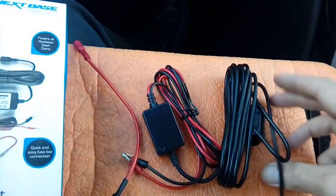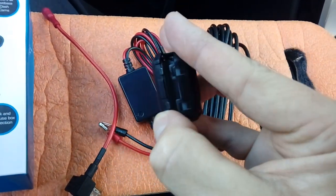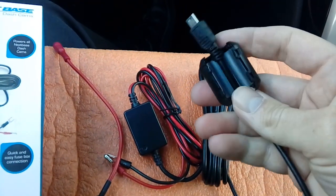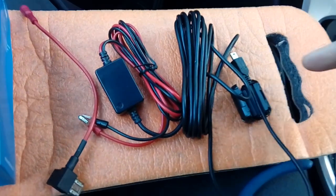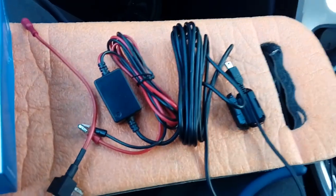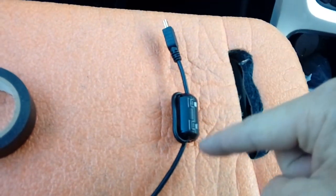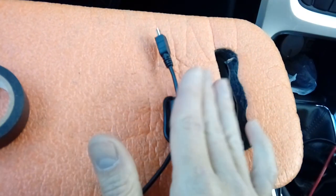Quickly back to your ferrite filter. Now they've got little clips on them. There we go. You can clip them open, so you just pop them open like so, and then wrap them onto the end of the power cable. Now what you have to do, I can't do this one-handed, so I will skip this on the video. Basically you go round, through and back again, like this. There we go, as if by magic. So down, loop round, back out, snap it shut. And that's your ferrite filter.